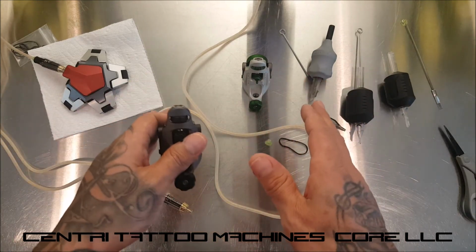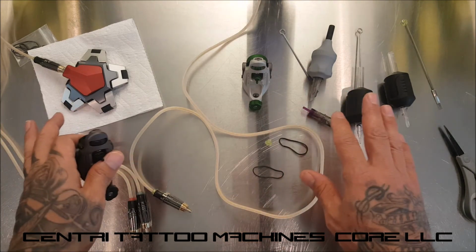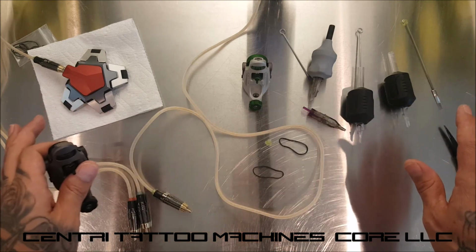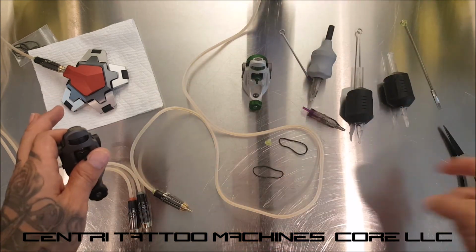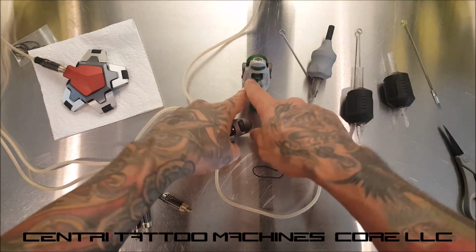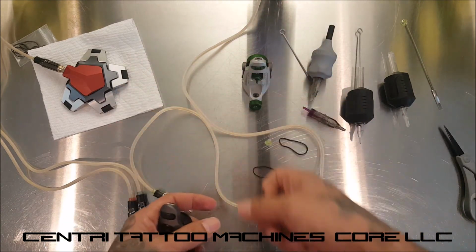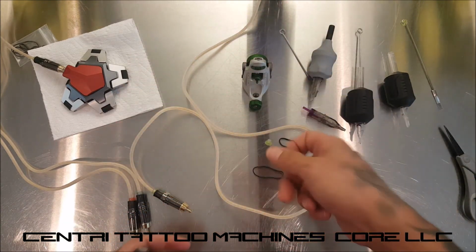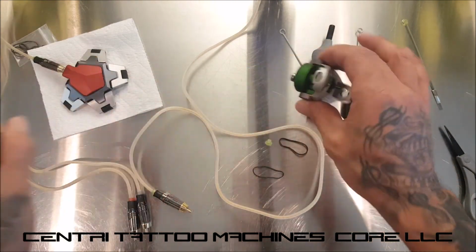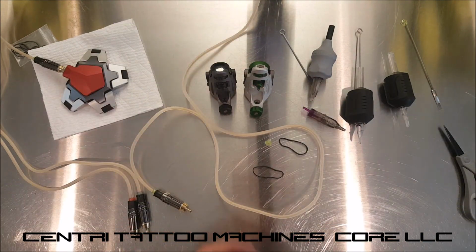Whoever sets you up, breaks you down, you need to show them what's electrical, what's not. They understand that everything needs to be sanitized, everything needs to be completely sterilized. And they're just coating everything, saturating it. And then they walk away, go have a cigarette, and let it do its thing. Well, all that time, it's just creeping through every little mated part in here. Then they wipe it down, think it's all good, walk away, and they just keep repeating that process over and over and over. Eventually, that water will get into the motor. It will cause all kinds of bad stuff. Cost you money, cost me money. So, please, take care of your products.